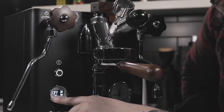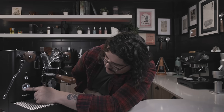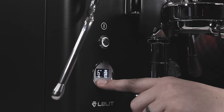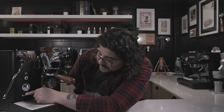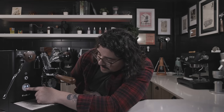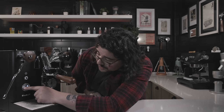Let me show you the menu. We toggle through using the minus button. Here's low flow start — I'll click plus, it'll flash twice, and now it's set. We choose when that low flow ends at the beginning; this will automatically start low flow when the shot starts. If I choose 15 seconds, it gives us that 4 ml/s until 15 seconds. Then for low flow final — if we want flow at the end — we can turn this on. So we start the shot, it's at about 4 ml/s.